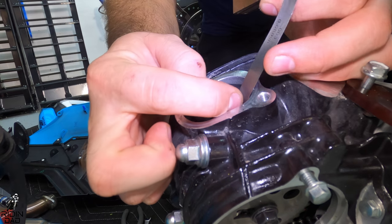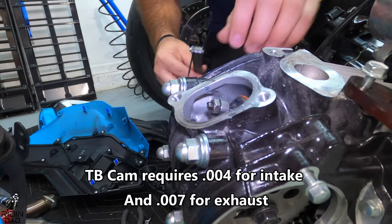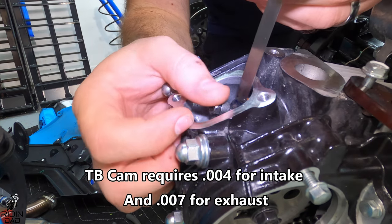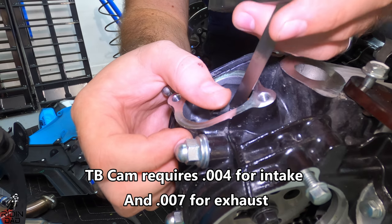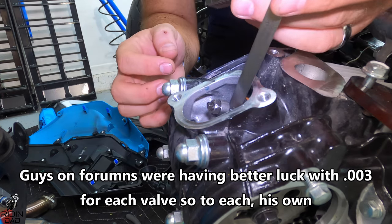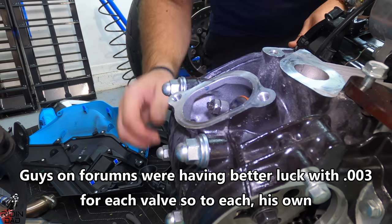You do need some feeler gauges. I don't remember offhand what I did. I should have looked it up. But I'll probably just write it in the description if you're really curious. But you're going to have to adjust the valves to whatever your cam manufacturer recommends. And then go ahead and cover the valves back up with the valve covers.